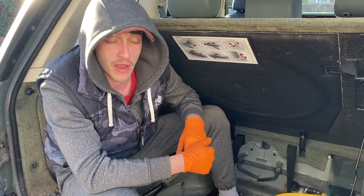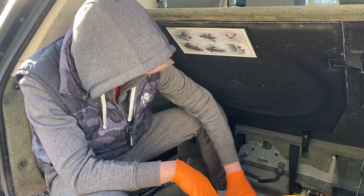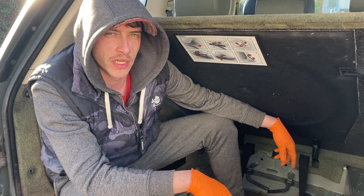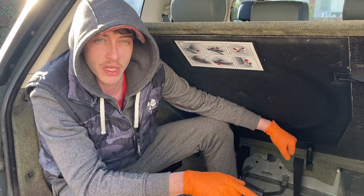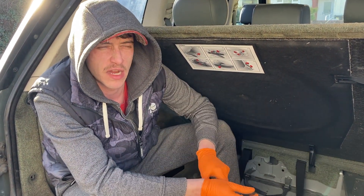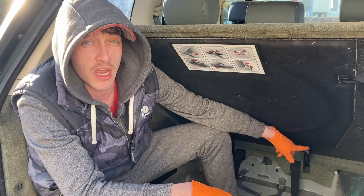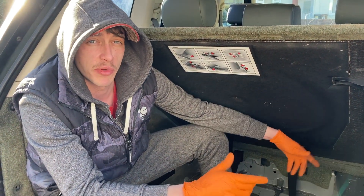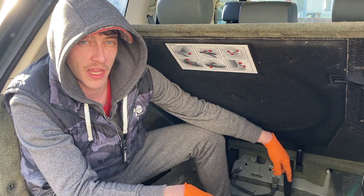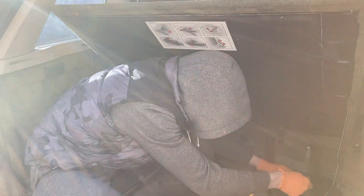If I'm ever in trouble again, all I need to do — since I always have my airline with me — is just tap into my air compressor and there we go. I don't know if it'd be good enough for air power tools, but for pumping tires up it's pretty good. The only thing to be cautious of: don't run this for like half an hour — it burns out around five minutes; two to three minutes is ideal. It's rated to do 140 psi into the tank. Ideally it'd be nice to tap into the tank but that's proper work. For a quick simple fix, I don't know why Land Rover don't sell you a setup like this — I think it's a great idea and it works.